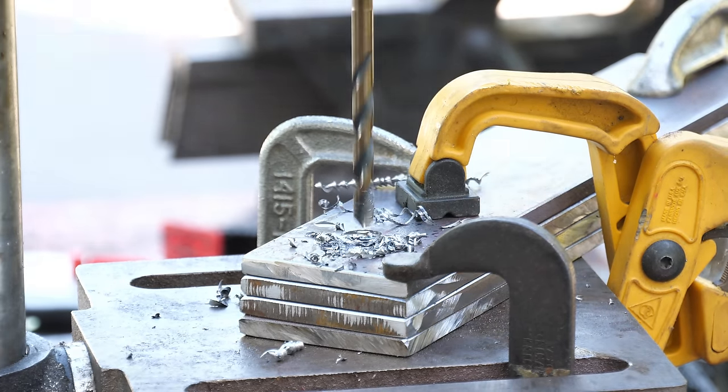But while everything is apart and set up to weld, I think I'm gonna put this in the driver's side tube just to have it there. I don't have any plans to run dual O2 sensors, but for diagnostic and tuning purposes, it could be useful one day to be able to switch the O2 sensor from one side to the other. For now, the driver's side one is just going to get a plug.